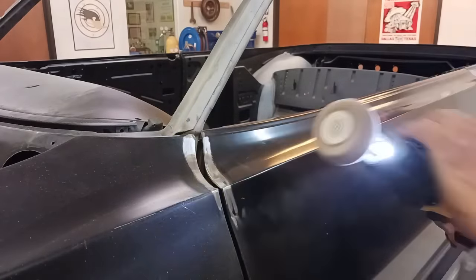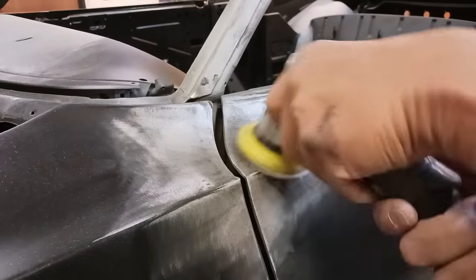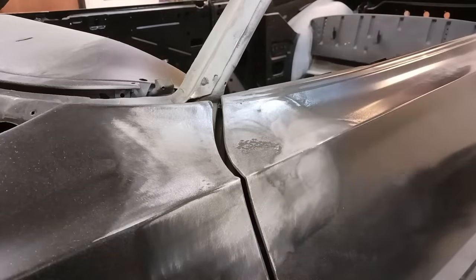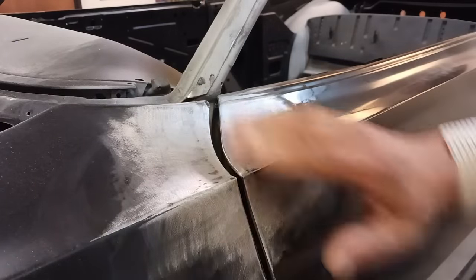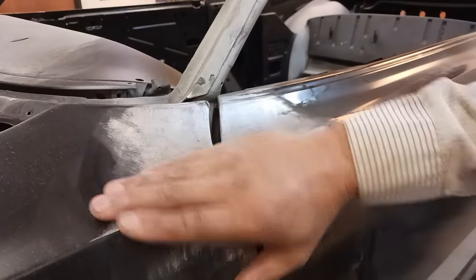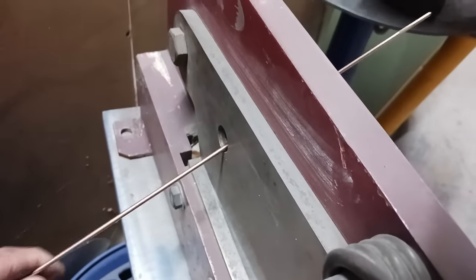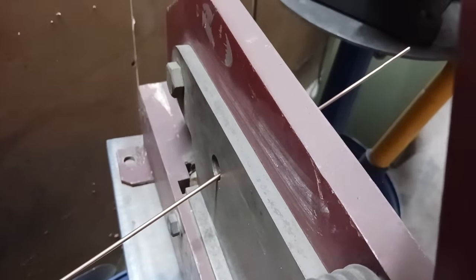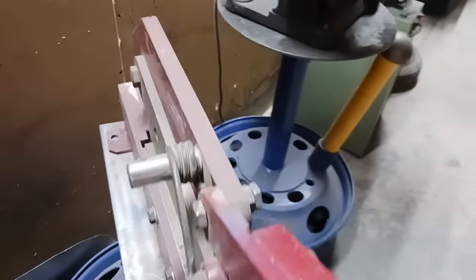I could add to the door or the fender. I'm choosing the door because that is easily reversible — say this door gets put on another car at some time in its life. Here's a restoration tip: you saw me just sand that stuff down to prep that area. Instead of blowing it, just wipe it off with your hand. Less particulates in the air, less you're breathing. Not a life and death situation once or twice, but if you're doing this for 20 or 30 years, it pays to be smart.